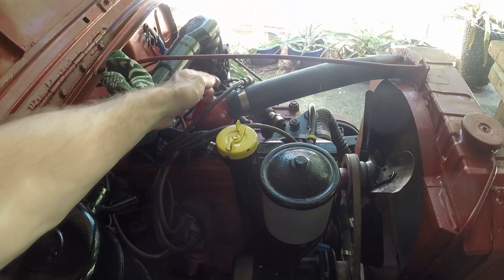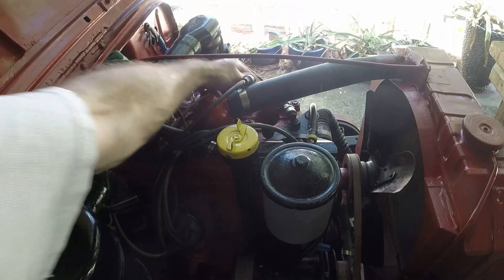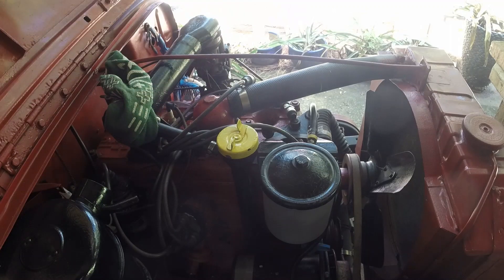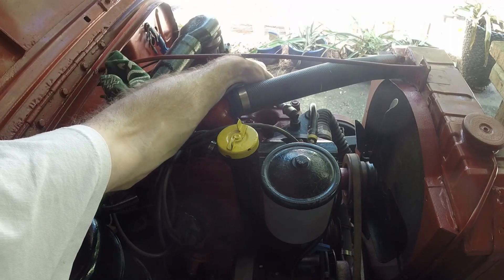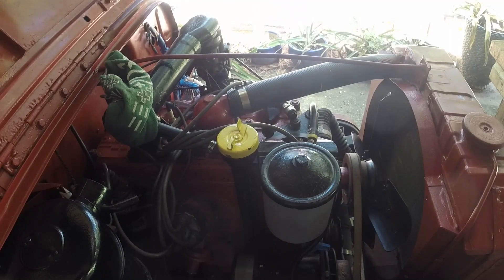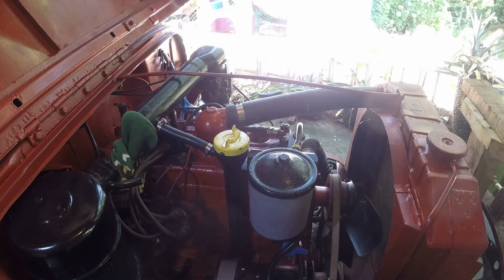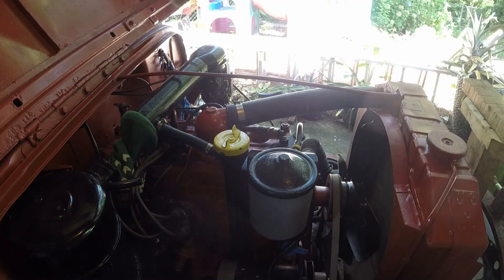It's just an awkward position where this particular coil wire is right now — it's kind of back in there. Let's try it again. I didn't see any spark. That's the coil — there we go, it sparked right there. So that's good. Now we're going to replace some of the wires and see if we can get that to work. So we've swapped out the ignition wires. Let's see if we get spark. Yes sir, we get spark.